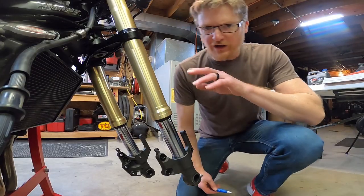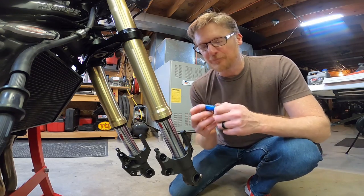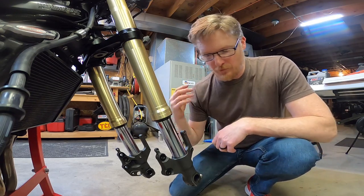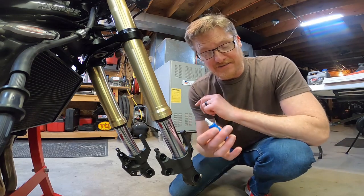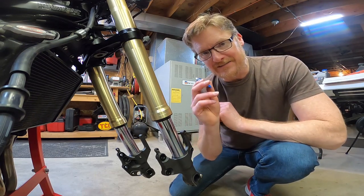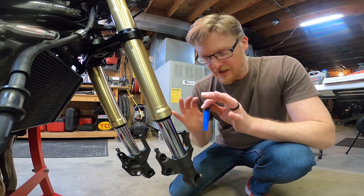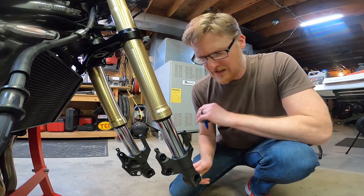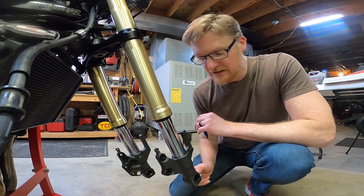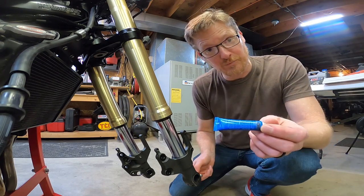All right, I just did some homework online. The thread locker blue is perfect, and I have some of that. It actually works well with stainless steel, and it's designed for things that have to be removed frequently, and it locks out moisture and it locks out dirt. So it dries nice and it repels the ugly, and it'll keep these threads clean, hopefully, so I can remove them more easily. So I'm gonna use blue.